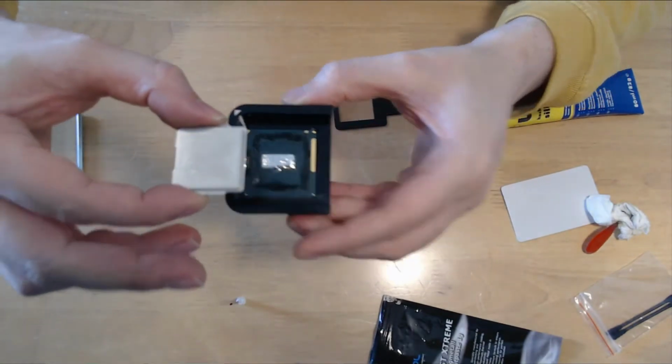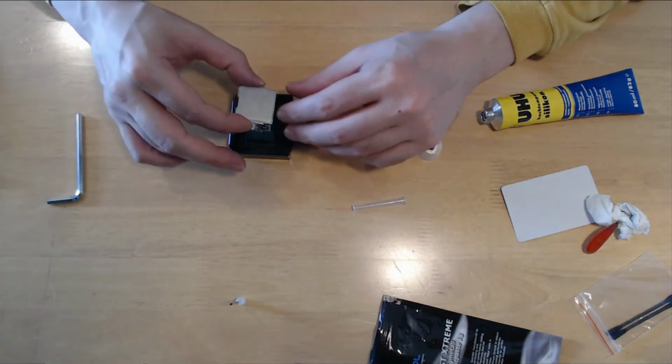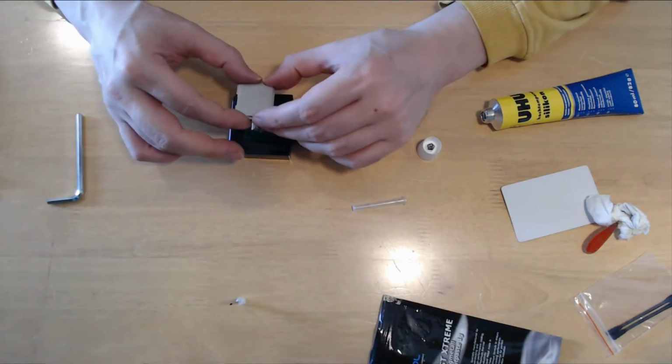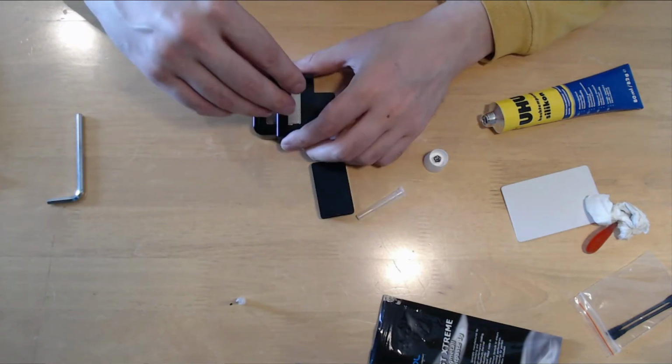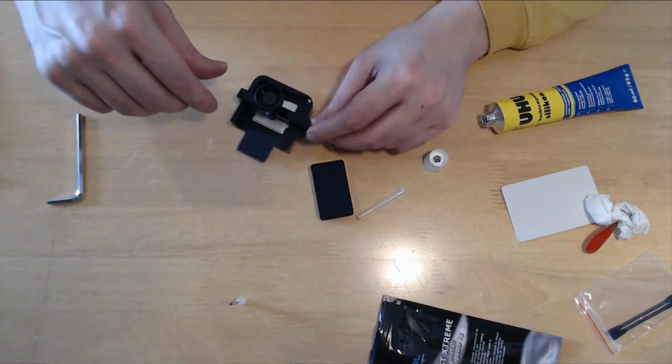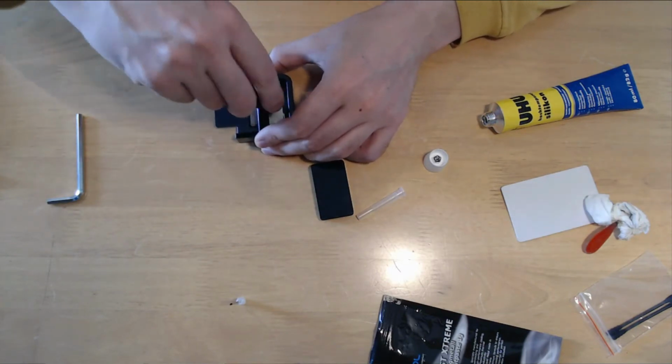After you finish, place the processor inside the delid tool like you did before, without touching the liquid metal or the silicone, and use the press tool to pin down the IHS for at least 3 hours. After that, the CPU is resealed and ready to go.